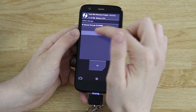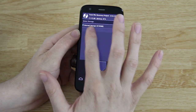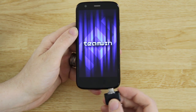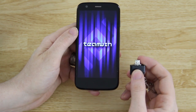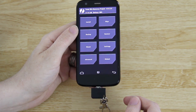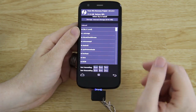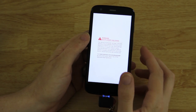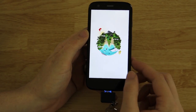If you hit Storage and see a newer version like 2.6.3.4 or 2.7.0 and you see a USB OTG option, choose that. That's also a way of verifying you can put the ROM on here and flash it — because you'll see the files on there. If you don't see the files, don't wipe your phone. Otherwise I hope you know ADB. So we're going to plug that in and go to Install. It looks like it's not showing up, so I need to take the ROM and put it on internal storage. Hopefully when you do this, TWRP will have updated to a newer version with a USB OTG option like on my Nexus 7 and other devices.